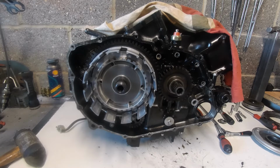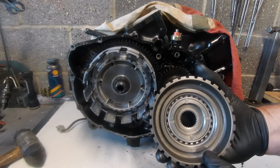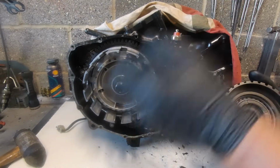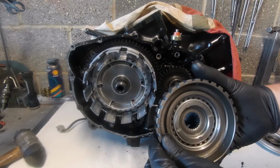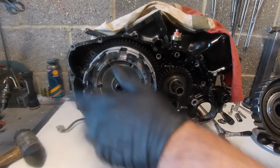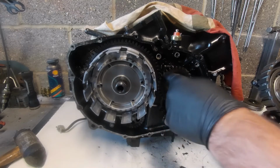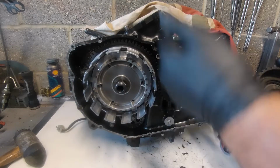So this is actually the slipper side of the clutch, because that is on that spline, it's fixed in that position. Yes, it's on the main shaft, but it's still fixed. Now, if the engine's rotating clockwise, this gear is rotating at something in the region of 3 to 1, 3.5 to 1, something like that ratio between that gear and that gear, but nevertheless it's rotating anti-clockwise.